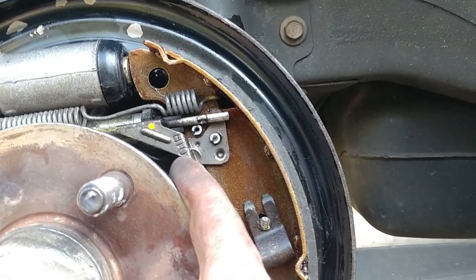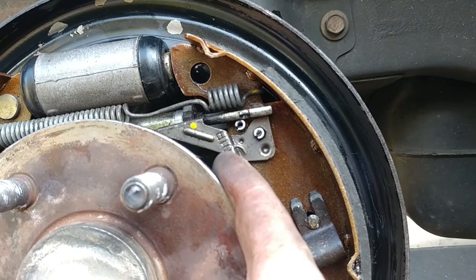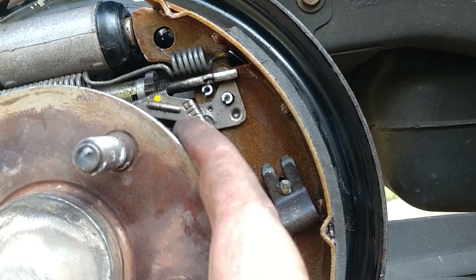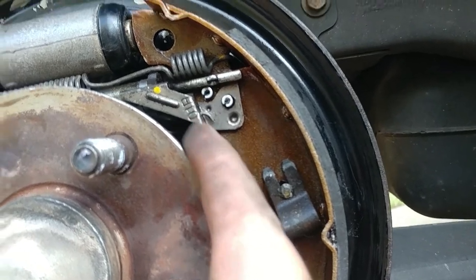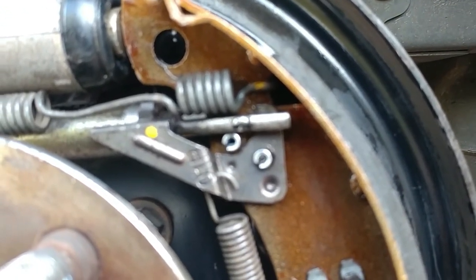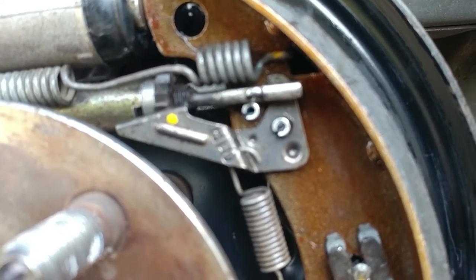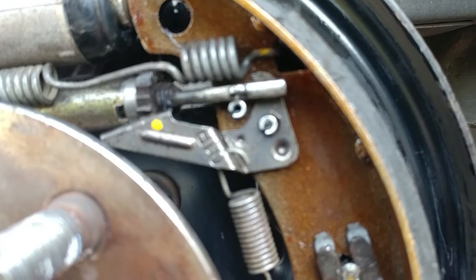Keep going, Dez. So on this car, all you gotta do is hit your brakes, and then adjust your brakes, your rear brakes. Go ahead and keep hitting it. Push it harder. You see it pull? You see it adjust that nut? Now to release. Do you see that? So every time you hit them brakes, it adjusts that nut. Do it one more time for him, Dez. Pull it. That's good. And then you let it go.